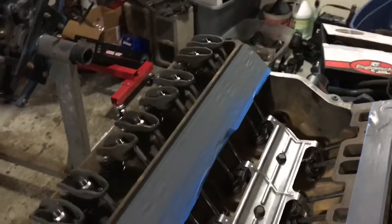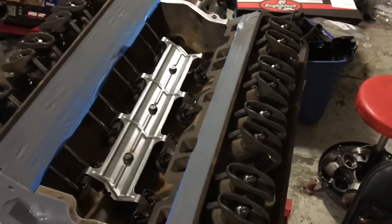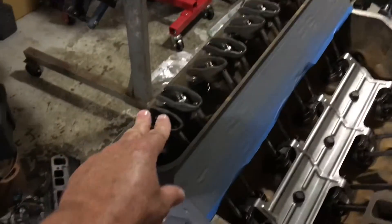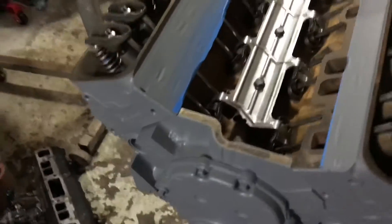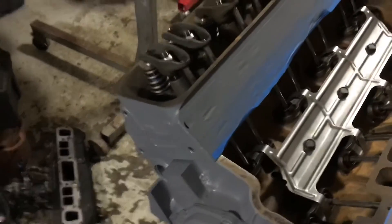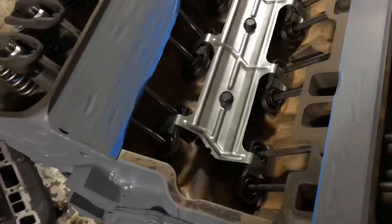Since I started adjusting these valves on cylinder number six, I just finished on cylinder number three. I've now finished adjusting all these valves, and in the process I determined that two exhaust and three exhaust seemed like they might have a problem. Two exhaust seemed like the lifter was stuck up and was not going to compress, because this spring was still down a little bit compared to the one next to it when that cylinder's on top dead center. I made a note to come back and look at two exhaust when done, finished all the valves, and I just checked two exhaust again - and it's okay. It just took a little longer, but the strong spring was able to push the rocker arm up, which pushed that lifter down. The lifter was just a real strong lifter - it wasn't compressing very easily.